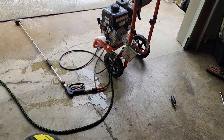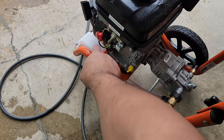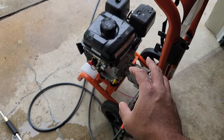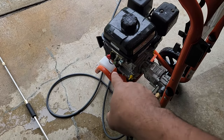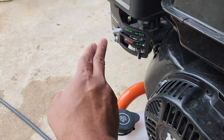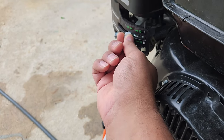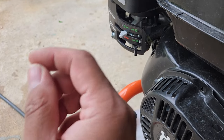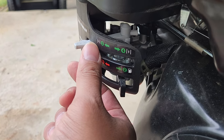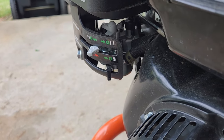I'm going to show you two ways to turn this off. For a quick temporary shutdown, I recommend turning it off from the kill switch here. Now one thing to be cautious about is the choke. When the engine is cold you start with the choke closed; when the engine is hot you start with it open. When you've shut it off temporarily, you may not know exactly how hot it is - you may need to leave the choke somewhere in the middle if you're having trouble restarting after a short pause. Position three is for a cold engine, position four is for a hot engine, and sometimes you have to feather it in the middle when restarting during pauses.